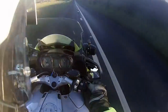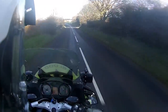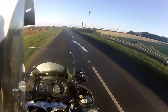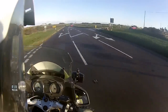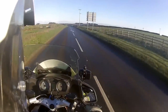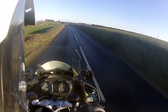They've said to us, yeah, we've got these Mutants, which is a bit of a new tyre, would you like to have a go of them? We're trialling them on big bikes at the moment. So this is a BMW R1200 RTP, it's the police paramedic spec bike, and we've got these Mutant tyres fitted on it. Tyre pressures are 36 and 42, or 2.5 and 2.9.